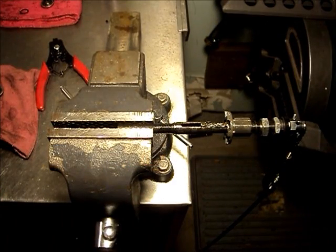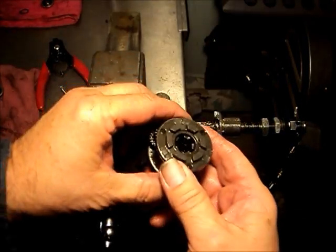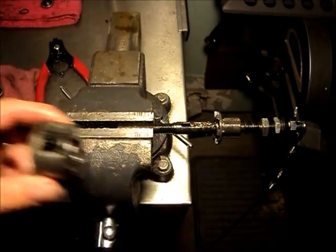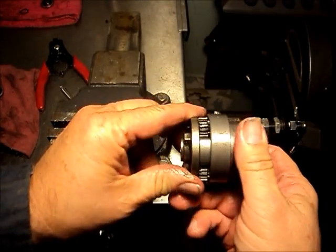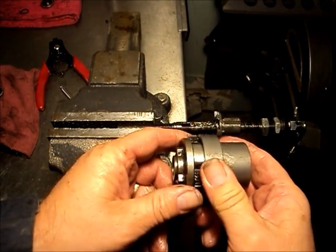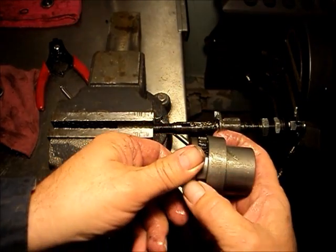When we move the shift selector to second gear, the clutch advances, but it still does not mesh with the planet carrier. The key has moved along so that it now meshes with the second sun gear. The input is still driving the ring gear. Now the planet carrier will rotate at a ratio of 75% of the input — so we have one rotation input to 0.75 rotations output.